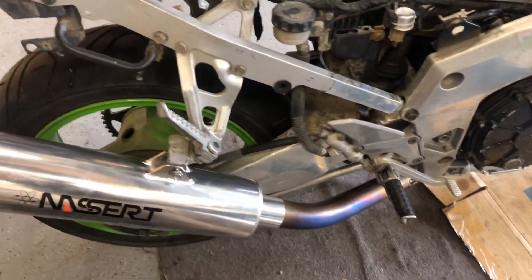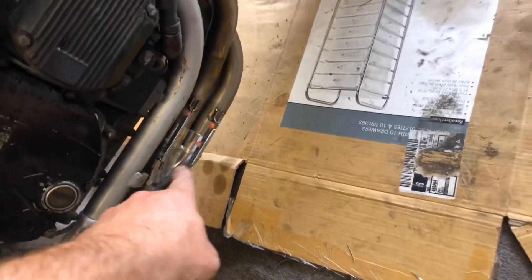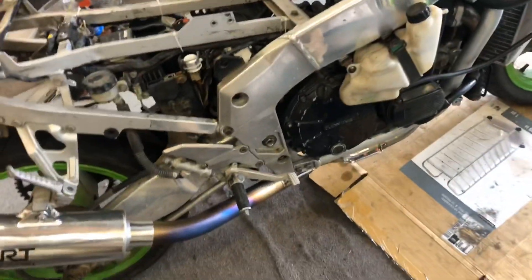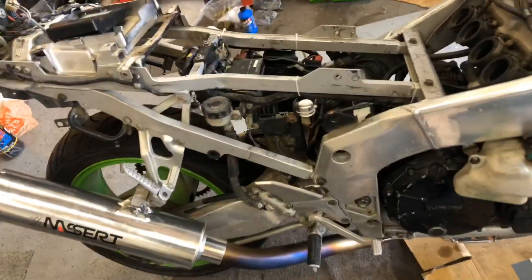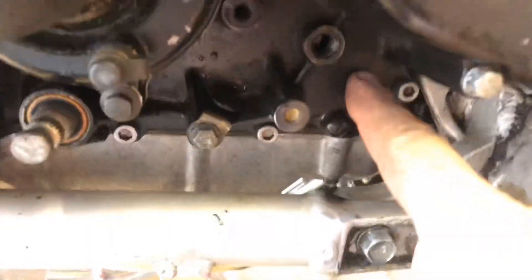The exhaust is sitting out and back a little too far, but I think a lot of that has to do with the way this collector goes into these head pipes. So what I'm going to do now is get a battery and see if I can turn this thing over and see if we've got spark. The only reason I'm hesitant to go any further is because I'm missing a piece down here - the neutral sending unit.